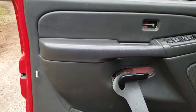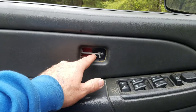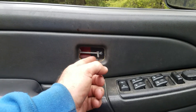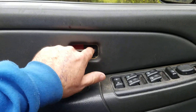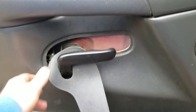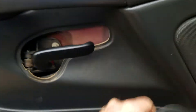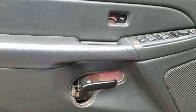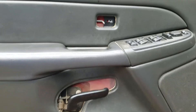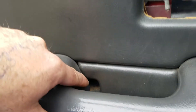Now looking at the door panel, the first thing you're going to do is snap out your little lock indicator, and there's a 7mm bolt hiding right back there. Next thing I did was pop out this little piece — it just makes it easier for the door panel to come off. Once you get that popped off, it's two things out of the way. Now for fasteners: there's a 7mm bolt there, and a 7mm bolt hiding out there behind the door handle.